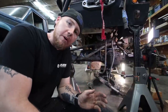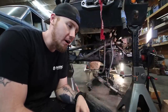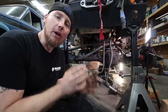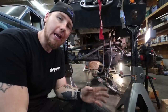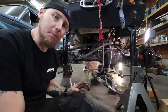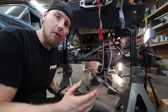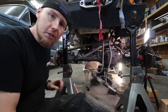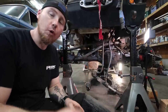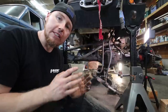This gray bar is a track bar I've been running for about 10 years — it's the only bar on the whole Jeep that I didn't build. It's a Rubicon Express bar made for a Jeep with a three to six inch lift. I planned on upgrading it but I'm actually going to keep it. It's not optimal because you want the length of your tie rod to be really close to the length of your panhard bar, or track bar as Jeep calls it. When these lengths don't match, as the front axle travels up and down over bumps, it's going to push your wheel right to left. I'm going to give you a demonstration of exactly why.